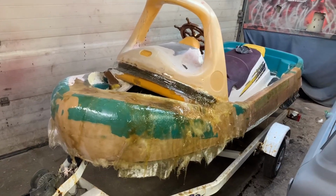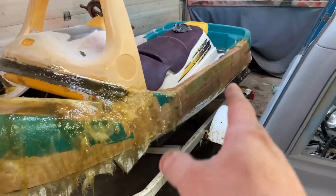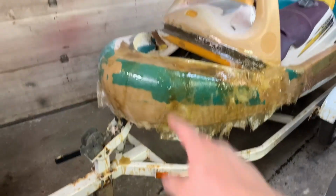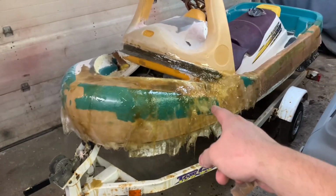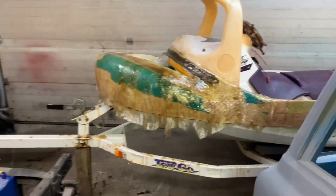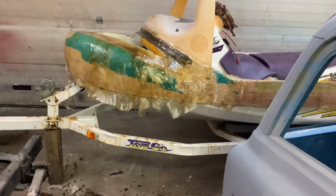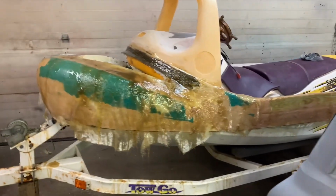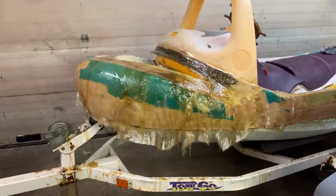First coat of fiberglass is down on the boat. Real happy with how the sides came out. Real pissed off at how the front came out. I was doing good till here, and then the resin started getting hard. I figured when I was mixing up, I mixed up like a half a gallon at a time, I figured it would take a long time to dry since I was mixing up so much. Oh no. Still started getting hard in like 5 minutes.